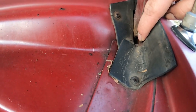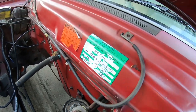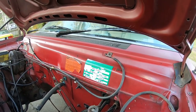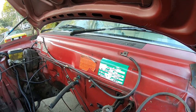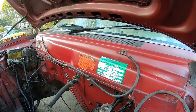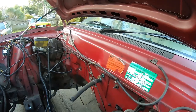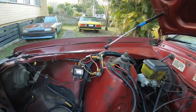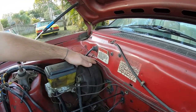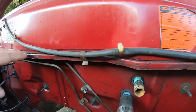Now this is the one Dan was waiting to reveal — we didn't want to ruin anyone's surprise for those that have one of these at home and may not have had a good look at their own car. You can get a torch, shine down in here, and have a good look at how the inside of the plenum is doing. They have a problem of filling up with mud and leaves over the years and starting to rust out. This one — we've looked in — it's absolutely mint.